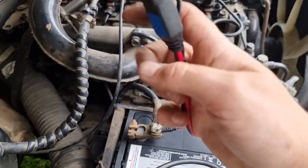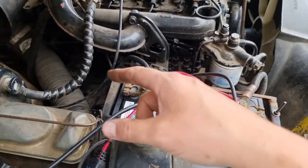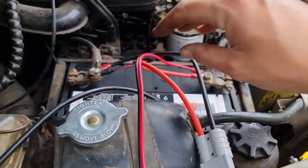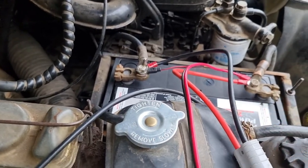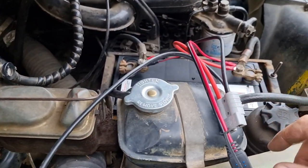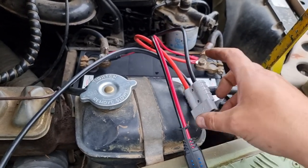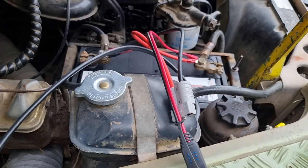We're in, and I'll need to zip the cables out of the way of this handle. Just to clarify — the Anderson plug here is for my Victron charger so I can't accidentally forget the clips. I can plug straight out of the 24-volt inverter and run the 12-volt charger off that — charging my 12-volt battery off the 24-volt system, which is handy. I'm running the radio off another Anderson plug inside. It also means easy isolation of the radio — if I'm parked for a long time I can just pull the plug, or if I need to run an air compressor I can plug straight in instead of using clips.